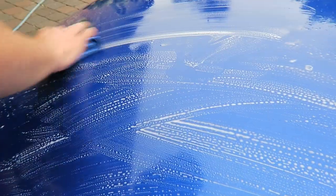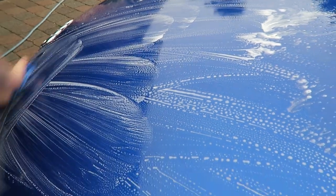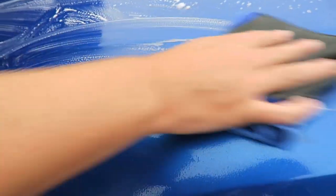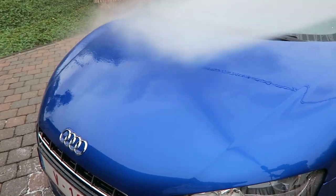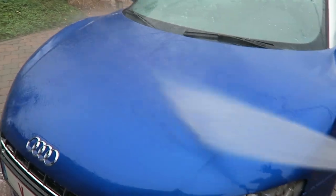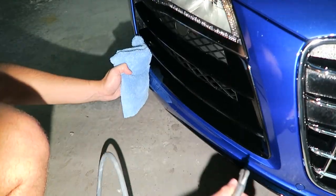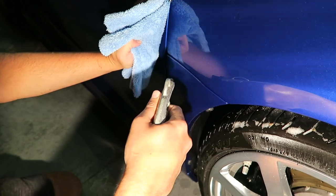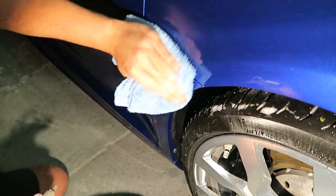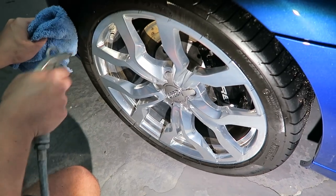At this point I decided to clay the car — just with a clay mitt. It doesn't remove contaminants as much as a clay bar but it's really fast. The car wasn't heavily pitted with contaminants but it still felt a little bit rough, so this did the job perfectly. I did the whole car in like 20 minutes. After the entire claying there was literally no beading left — I don't think I've ever seen worse beading. After that I dried the car, pulled it inside, and used an air compressor to blow everything out of the seams because of the vibration of the polisher: all the water suddenly starts coming out of the seams, gets into your pads, and often has dirt like sand in it.